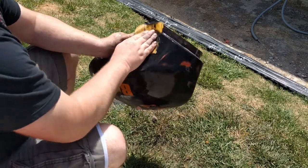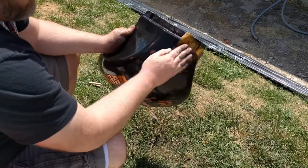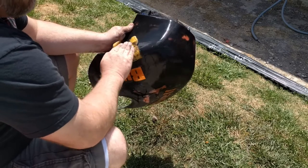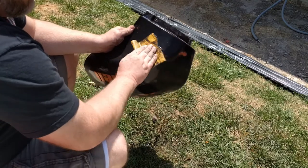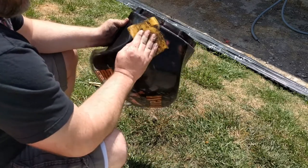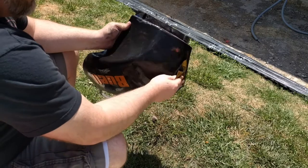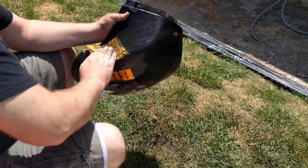This is a bike. I'd really be taking my time going through all the grits and glazing and re-glazing, putting down primer filler, and wet sanding the primer filler until it was as smooth as I could make it. Then I'd clean that off and put down my base coat and then the clear coat. But we are not doing that because we're just buying time until the carbon fiber shows up and then I don't have to do anything.